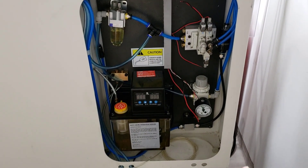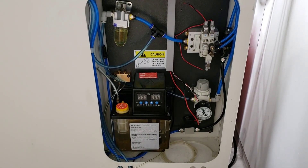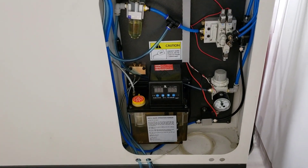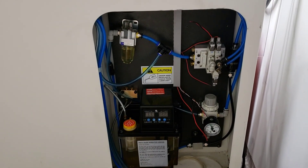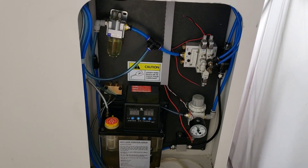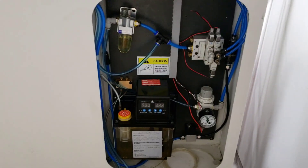So what I did is based off work that a guy from the forums named Jack started. He realized — or almost had a crash — that the air gun can consume a lot of air. It can consume enough air that the regulator isn't high-flow enough to feed it — which is just an open hole — and to feed other things. So the air pressure can drop fast enough that if you were running the air gun during a tool change, the hood might not actuate properly. If you happened to time it wrong with a power drawbar, you'd have the same problem. It will air out and stop the program, but you could potentially ignore the air-out, hit clear and run, and it might not reset fast enough. So he either did crash or got very near a crash.